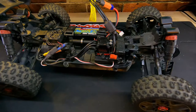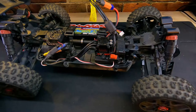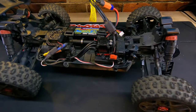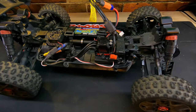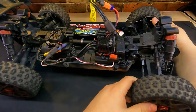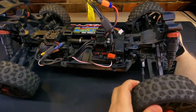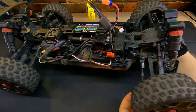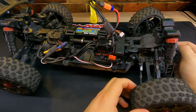What you see in front of you is an Arma Typhon. This Arma Typhon has a pretty common problem that we see in a lot of RC models, where when we power on the system and pull the trigger, you get a nasty noise and the vehicle doesn't really go anywhere. Now this most commonly is something in the spur gear assembly, located here. We can do a little more diagnostic just to make sure. If we stop one of these tires — I'm going to stop this tire that's furthest away and roll this tire — this will make the drivetrain bind up, and you can see the rear tires that are turning. So we know the issue is not in the differentials, front or rear, but instead something in the center drivetrain.